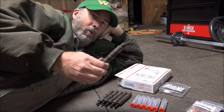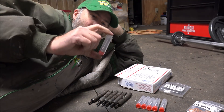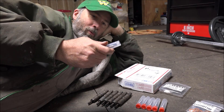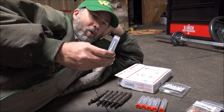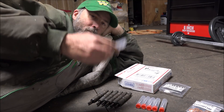I'm working on a fueling upgrade for the Crew Cab. What I've got here is a set of Power Driven Diesel 7x11 injectors. These are a pretty affordable injector, and since I have 307 gears and my truck doesn't turn a lot of RPMs, I think the seven holes will work out pretty good.